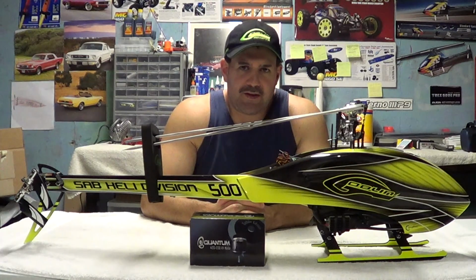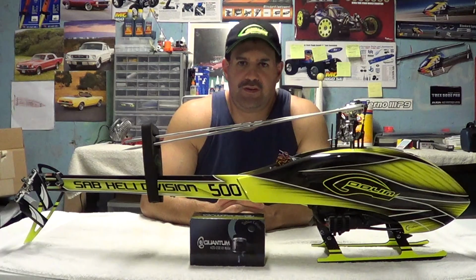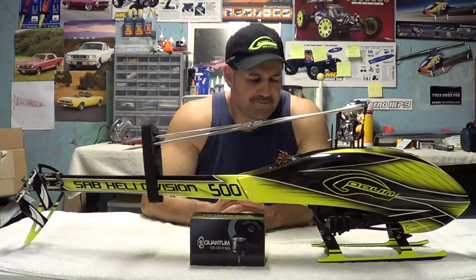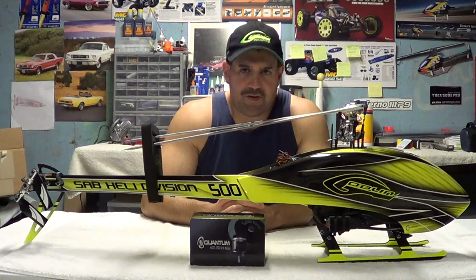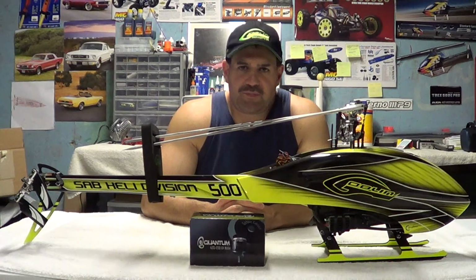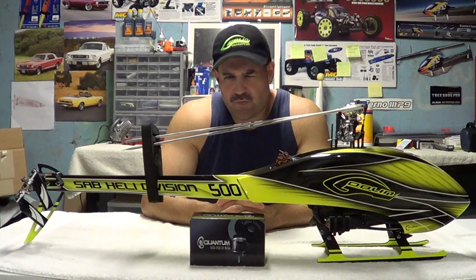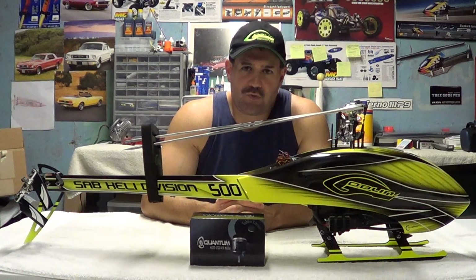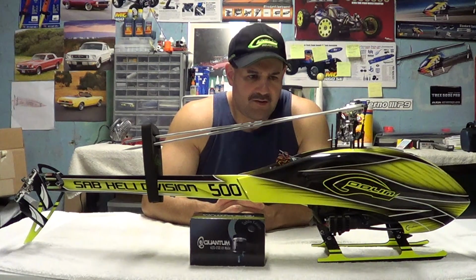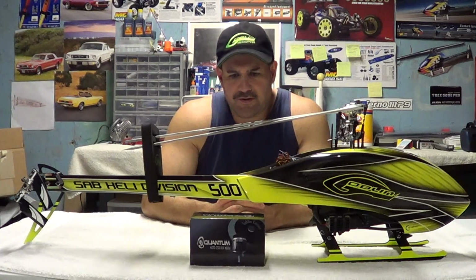Well guys, I'm on my third motor now with this helicopter. I started with the Scorpion 4020 1100 kV, and I wasn't getting the performance that I needed out of this. So I ended up selling that motor after only a few flights, and I went with the Scorpion 4020 1350 kV motor, the H3 model that most of the guys were using, and I was experiencing a lot of issues with that.